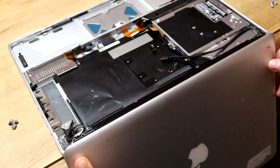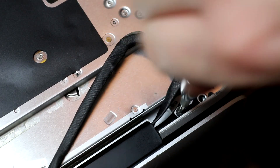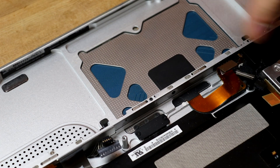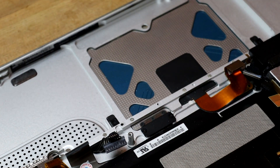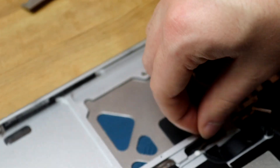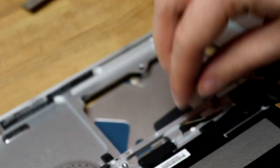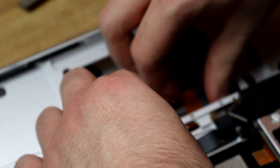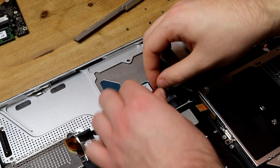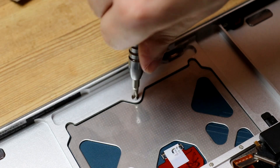This was a simple process of following our previous steps but this time in reverse. Before we reassemble any further, we still have the troublesome issue of the trackpad. To remove this, we need to remove the chassis divider by removing a series of screws positioned along the frame. With these removed, the divider easily lifts out, giving us greater access to the trackpad. There are a series of screws holding this in place, and with these removed, we can lift up the device and slide the original trackpad and its ribbon cable out. The replacement trackpad was actually reasonably difficult to position, particularly because of the shape of the ribbon cable and sliding it through its slots without tearing it. However, once this was done, we could re-secure the trackpad with the original screws.